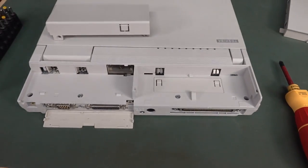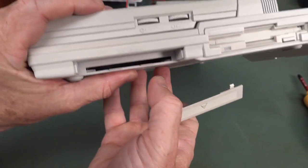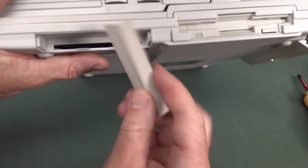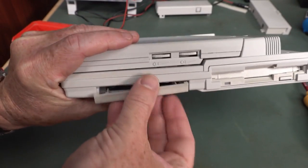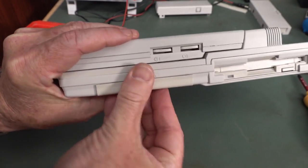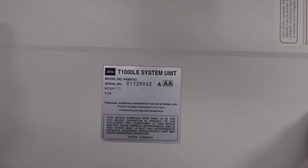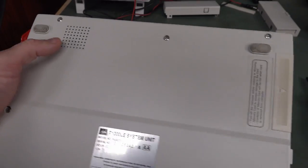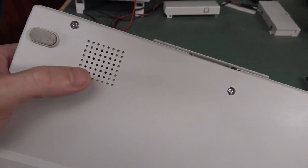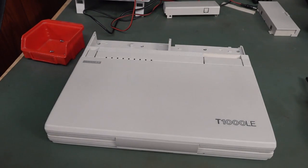There's also the expansion memory interface - none of that PCMCIA rubbish, it was a custom jobby. I think you could expand up to about five meg, which is pretty kick-ass. For you serial number aficionados, there you go - a TL1 system unit. The power supply is dated 1990, so it's at least '90 vintage. There's a little DOS speaker on it, but no Sound Blaster capability.